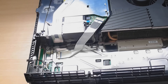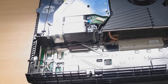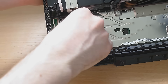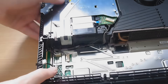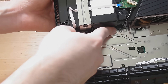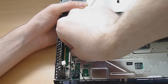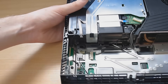The next thing you need to do is unplug this ribbon cable right here — unplug it on both sides and take the whole cable off. There's also a little black wire that runs down to the motherboard, so make sure you unplug that as well. There's also another cable that runs along the side of the disc drive — it attaches the disc drive to the motherboard — so take that DVD drive power cable out as well.